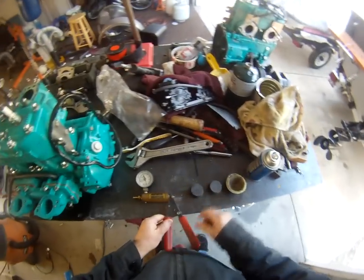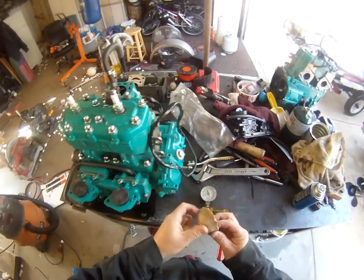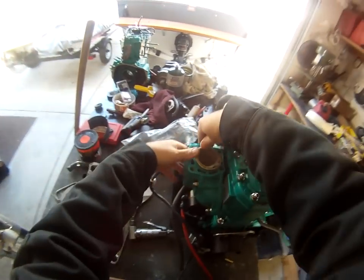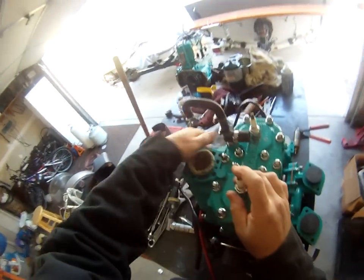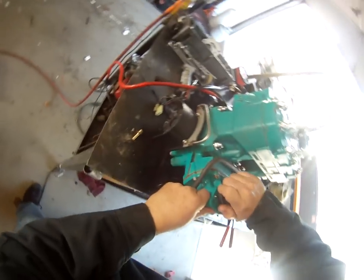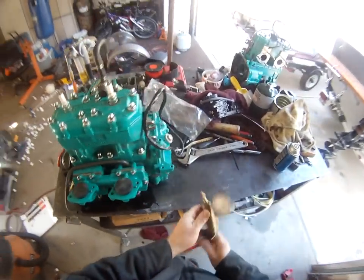The items you're going to need are a vacuum pump and two plugs for the carburetor — one goes here, one here. Then a tennis ball turned inside out. See the rubber here? You're just going to take and push the tennis ball in as far as you can — cut a tennis ball in half and use it because it's rubber and really soft, it usually will seal pretty well. Twist them a little bit and push down. Same thing for the other one.